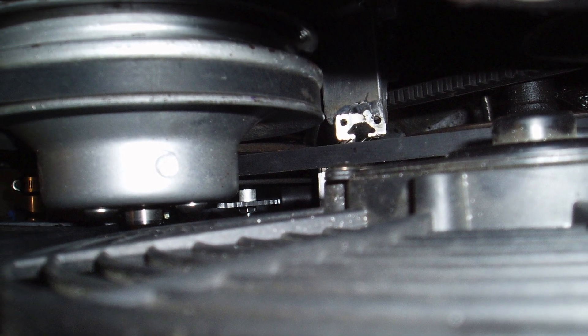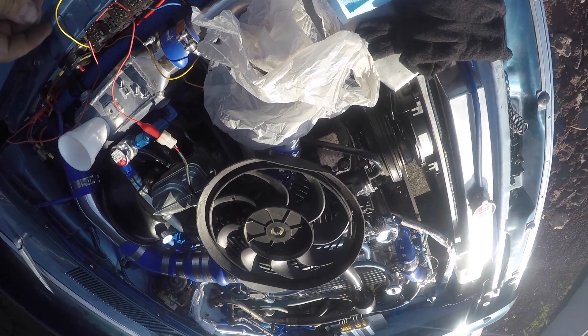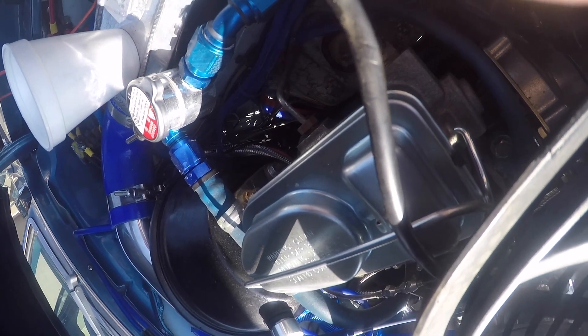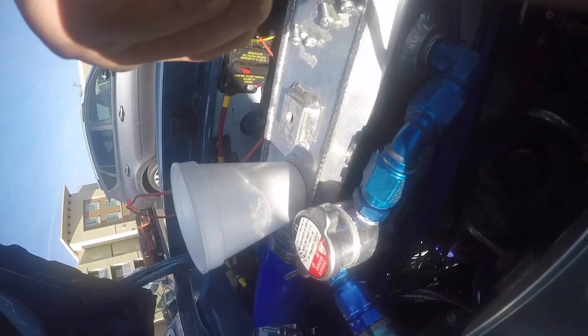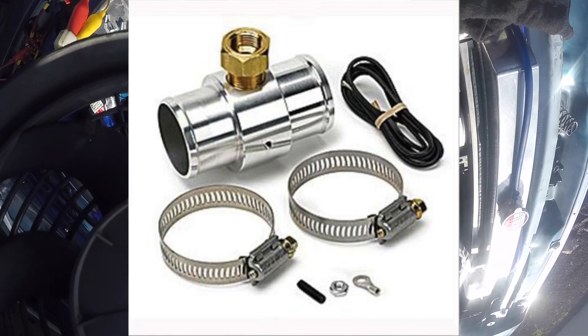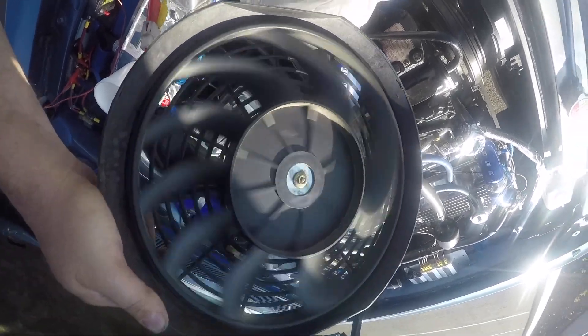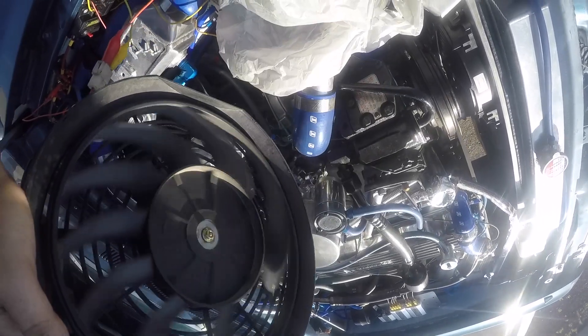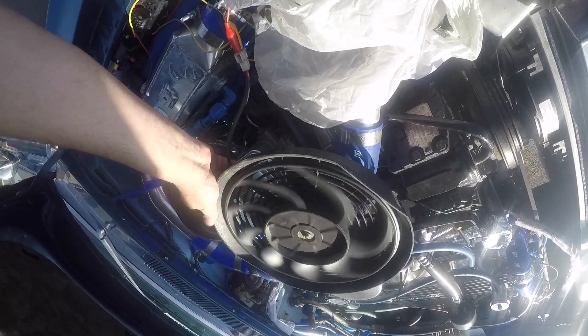To get this radiator in the car - it's actually for a modern Hemi which has a one and a half inch upper radiator hose and one and three quarter inch lower - I used a silicone coupler and an adapter to add a thermostatic control for the fans. I originally used that to trip a relay to control the fans: one triggered off temperature and the other triggered when the air conditioning was on. That worked okay as a carbureted car.